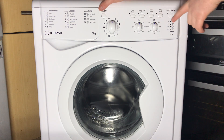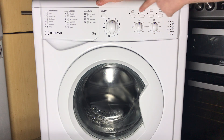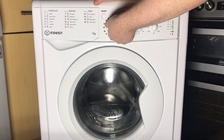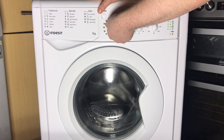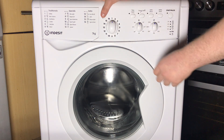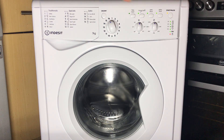The next process is pretty quick because you have to make the knob movements while the lights are on — otherwise it won't go into service mode. So: on, one position to the right, off, back to 12 o'clock. On, two positions to the right, off, back to 12 o'clock. On, drain and spin, off we go.